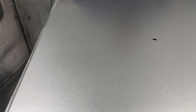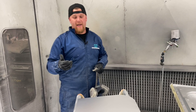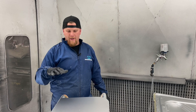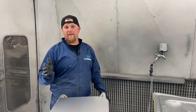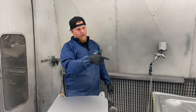Now when you look at the test panel after the orientation coat, it has a different, slightly more hazy look. Waterborne paint will be completely flat when fully flashed — that's one advantage of waterborne versus solvent — but they act the same as far as how the metallics orientate. We did a very tight overlap and turned the pressure down. This panel in the sun is not going to look splotchy or tiger-striped. If it still looks that way, add more paint or practice your orientation coat.